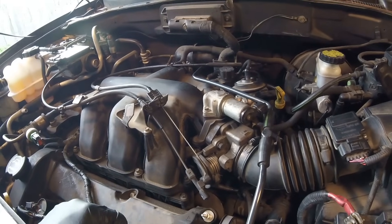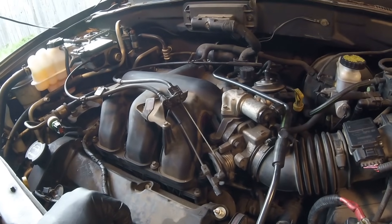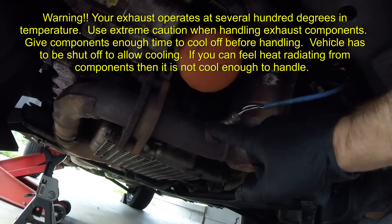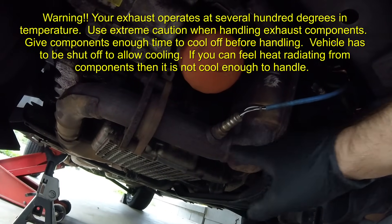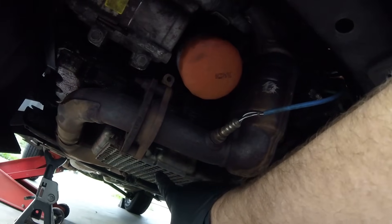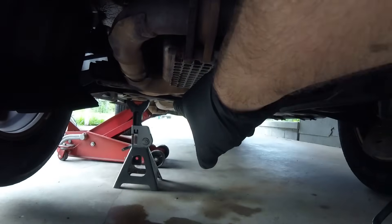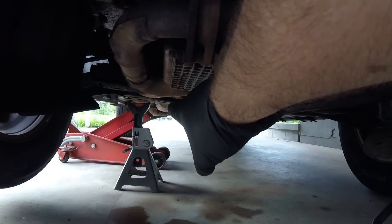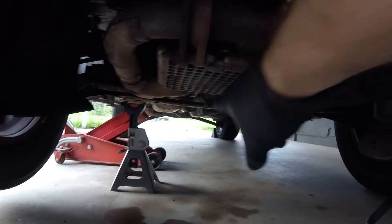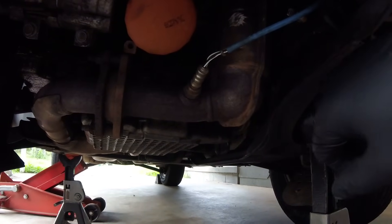When I held it up about right there, the vacuum went down to zero and it stayed at zero and it never recuperated and went back up. So right off the bat I suspected I had a clog in the exhaust system, so I proceeded to take out one of my O2 sensors and let it run to see if it would alleviate the clog. This is the O2 sensor I'm going to take out — it's just after the front catalytic converter on this side. On the back side there's another catalytic converter for the back head, and then there's even another catalytic converter further down on the exhaust pipe. That's where I suspect my clog is, so I'm going to take this O2 sensor out and run it and see what we got.